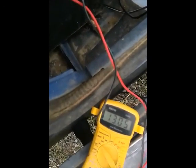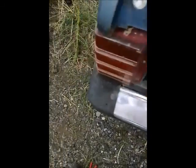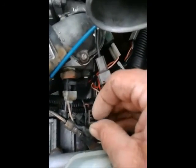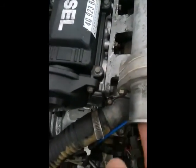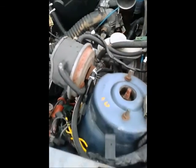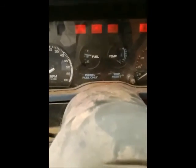Let's see if my connectors are good. We're going to start this thing up. I've figured out why it would suck a battery down in a heartbeat - because of this thing, the little preheater. See how it kind of melted when I hooked a good battery up? This is 12-volt, gives the air some warm charge going in as needed. Apparently the relay is froze up on it. Let's see if we can get this thing started - it's been sitting with the same fuel in it for three years. Hear the fuel pump kicking? Diesel fuel only.